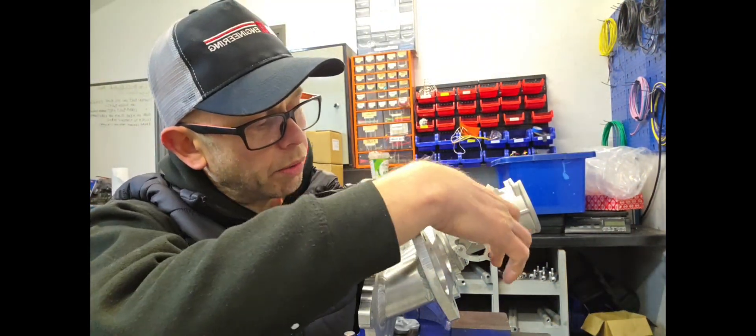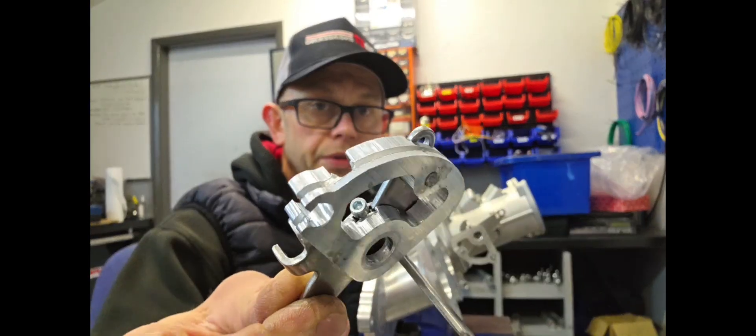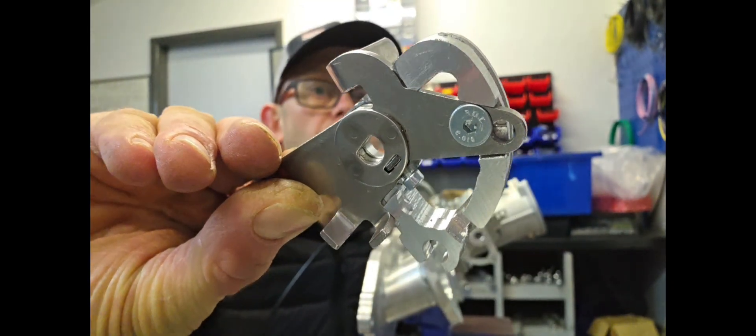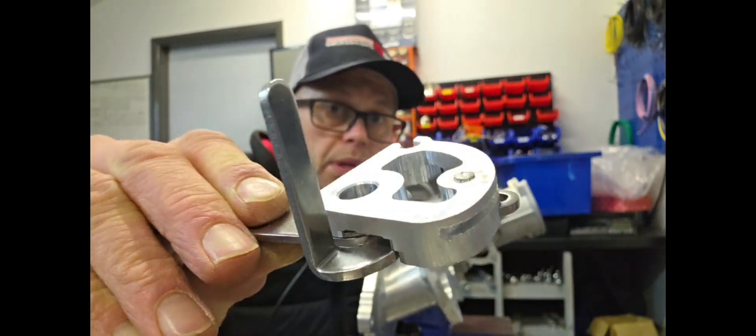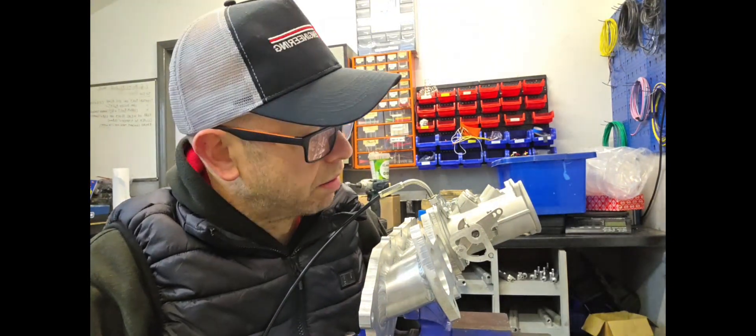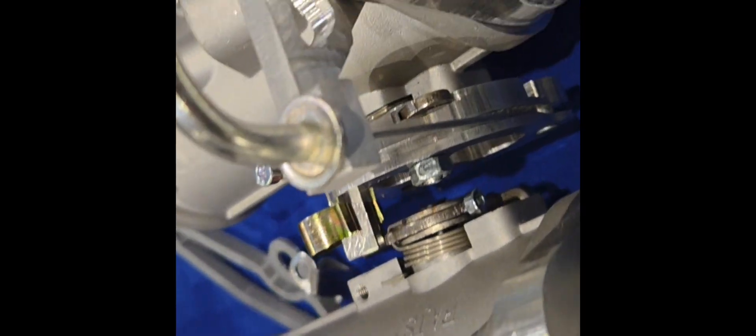So we've taken a bit of a leaf out of the motorbike throttle body book and come up with a quadrant that is basically retrofittable straight onto the standard lever arms. This nice CNC machined quadrant — the linkage arm is let into the quadrant and held in place with that countersunk screw. Basically it converts those levers from their awkward straight-line design — straight lines pulling on straight lines, which is not really smooth — and gives you a proper quadrant.